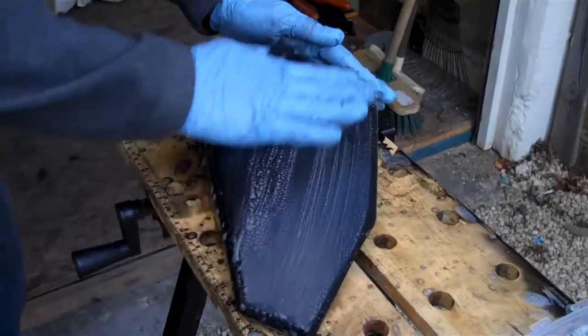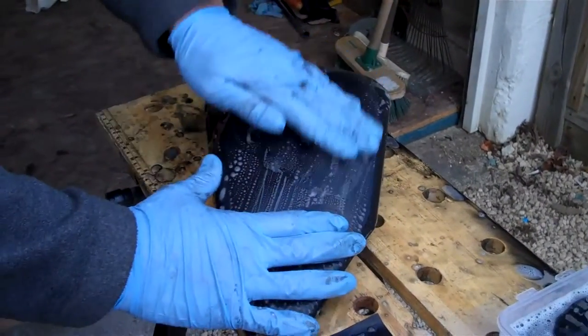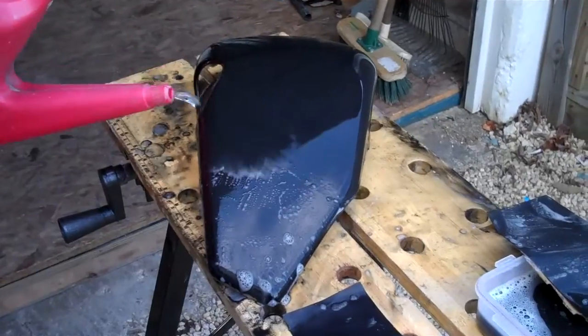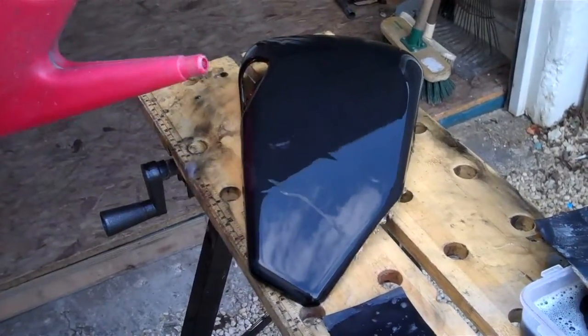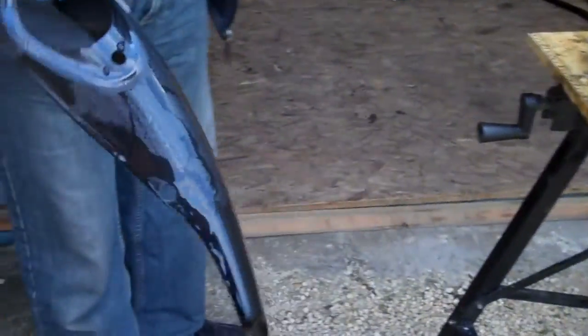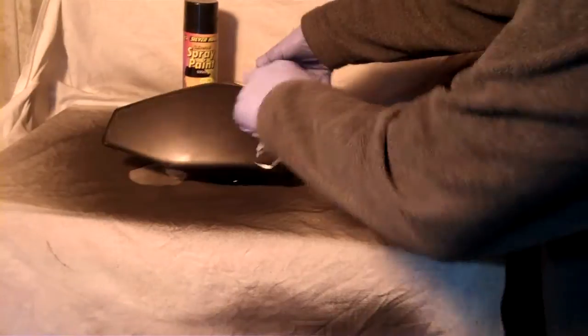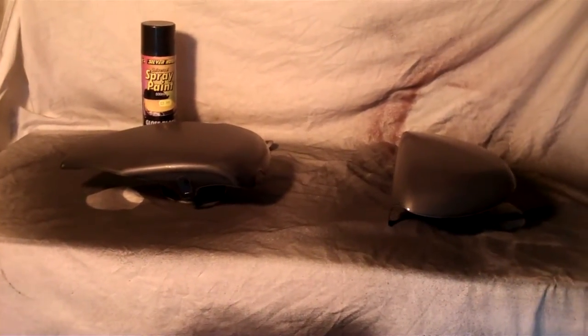Here we pretty much are. The second panel is pretty much done. Just time to water that off and dry it. That's now nicely sanded back. Get some fresh paper, clean those up, and time to get a tack coat on. This is just to lay a very thin coat of material over to go tacky — it does what it says on the tin. It's not designed to coat up; it's just there to form a bond between the dry stuff and the wet stuff.